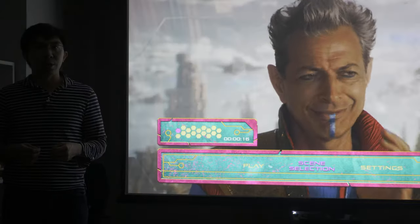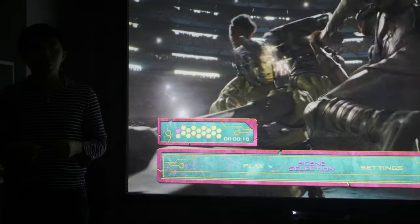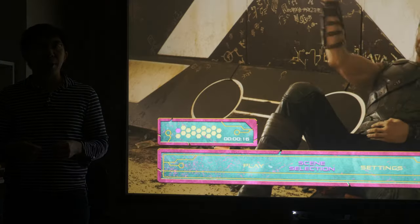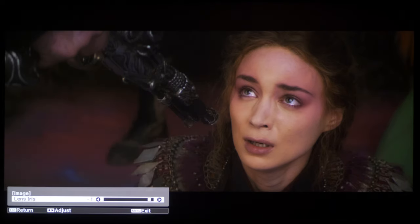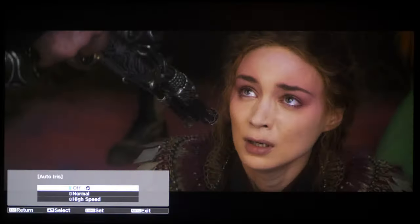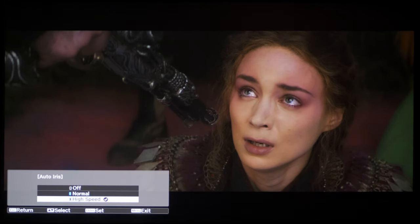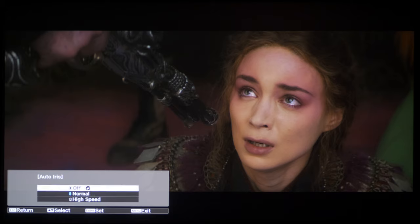Black level wasn't as deep as the Sony's, let alone the JVC's, but it's noticeably better with punchier contrast than all DLP projectors including the BenQ's. There's a dynamic iris on board, and you can manually clamp down the iris using the lens iris control to cut the light output and achieve deeper blacks. Engaging auto iris didn't introduce as much pumping artifacts as what we saw on the Epson LS500, but didn't deepen the blacks in most scenes either, so we're probably tempted to leave it off.